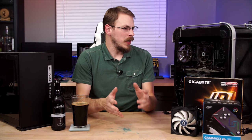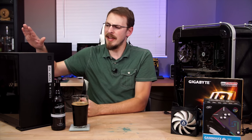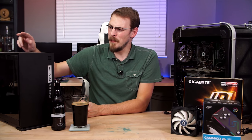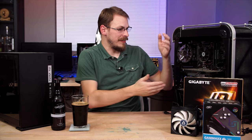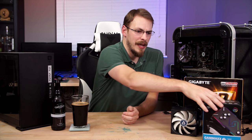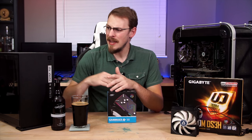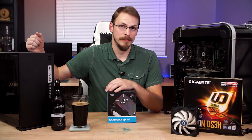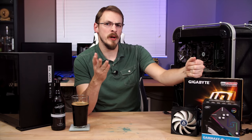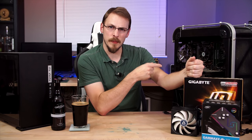What exactly am I doing today? Well, I'm going to swap the majority of the guts from this system over into this case. This is an InWin 301 and it is not the best airflow case, but number one, it's a much better looking case. Number two, it's going to be a lot quieter because it's a closed box. I will also be upgrading the cooling to a Deepcool Gamax GT, trying to keep that CPU under 80°C even though I'm going to more of a closed chassis. I'm also going to be swapping out my Z370 motherboard for a Gigabyte B360 chipset because there's no point to run an i5-8400 non-overclockable SKU on a Z370, and that'll free that chipset up for some other purposes.